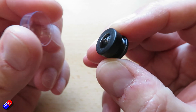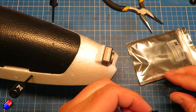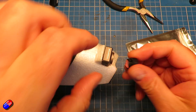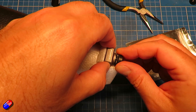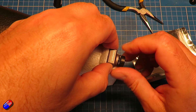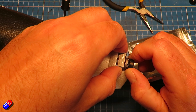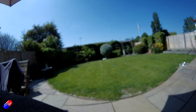Once you have that out, screw it into the same place as the old lens and leave the locking ring a little bit loose, but try to get the gaps about the same. Don't go mad with the tightness and don't do the locking ring up yet, because we need to fine-tune the focus. Fire up the camera, point it at something 20 or more feet away, and turn the lens until you get a pin-sharp image.